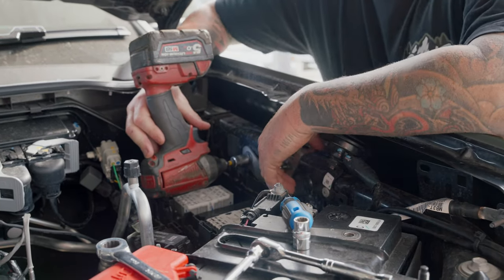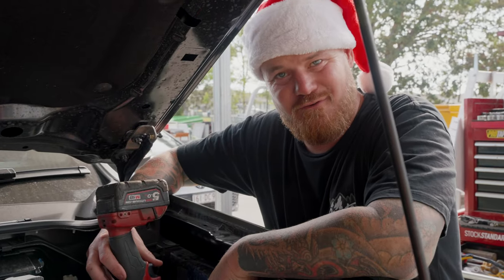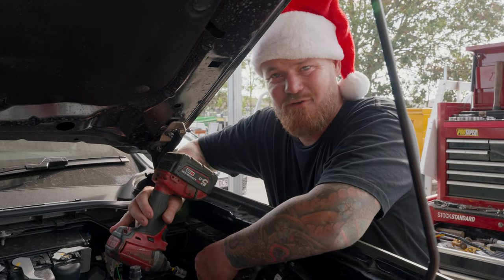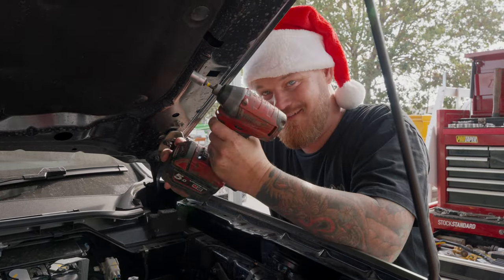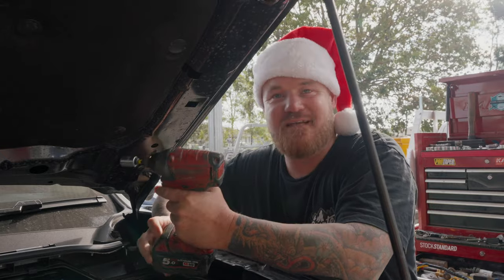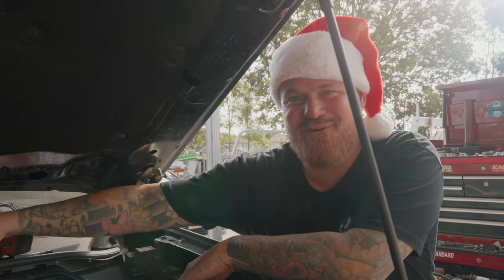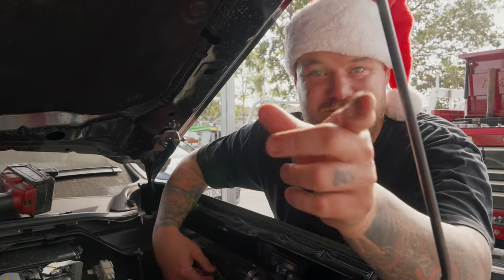It's been mentioned to me by someone on our Facebook page — thank you, I think his name is Adrian — this bolt has to be tightened back up to a minimum of 30 Newton metres. What we do is a couple of duck-a-duckers with the rattle gun; this bad boy is good for about 200 Newton metres so a couple of shots from this one and she's all good. But if you snap the bolt, that's on you.